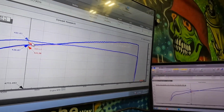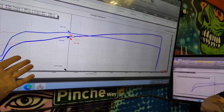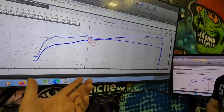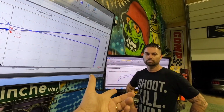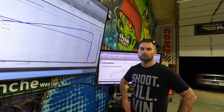And at the end of the day, you're still stock manifold. That car is completely stock. This is the ESS kit with a completely stock setup. No booster in the tank. This is what you're going to get when you go to Shell, Shell 93. I mean, you can honestly probably go get better. I have literally, in the past, my Whipple car, for example, pulled 2 degrees of timing on one gas station and added a degree of timing at another gas station. It makes a difference.